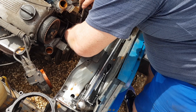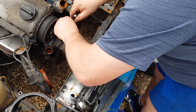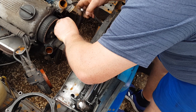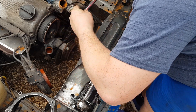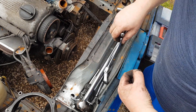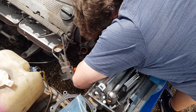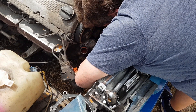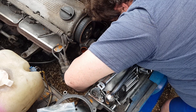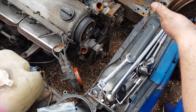This was an eye-opener. If you look at the front part of the belt, you can see some scoring — yeah, that's not good. What's probably happened is during one of my many excursions to the gravel trap, a stone has got under the cover of the cam belt. This is according to some of the other guys that race — apparently it's quite a common occurrence.